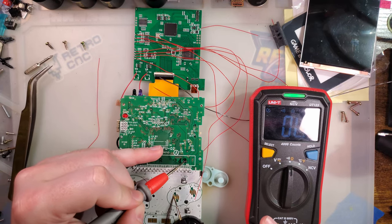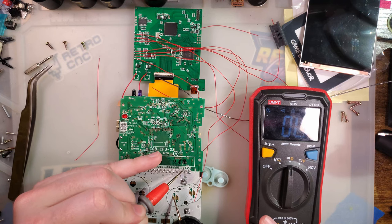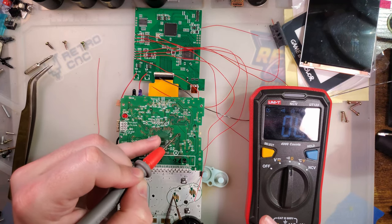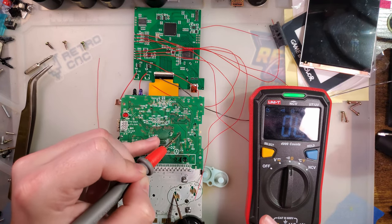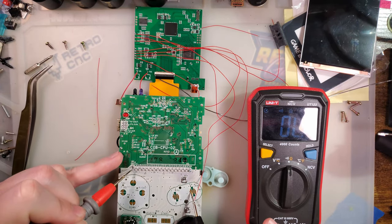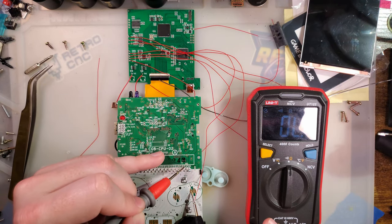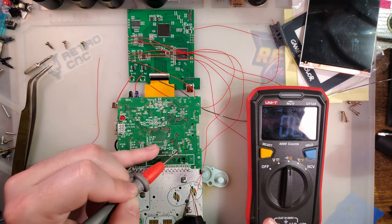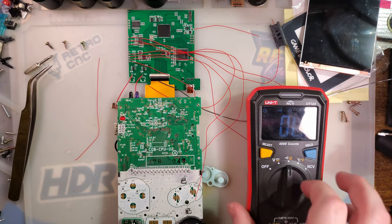So in this particular case, B is connected to, if you look at the cart slot right above the WR pin, that's what B is connected to, or we can use, in this cluster of four, the bottom right one. I'm going to go with the bottom right of that cluster of four. We will also need A, which is probably that top one in that cluster of four, yep, and the right one right above the not pin. I don't know what that actually is. It's a little circle with a line through it. But it's to the right of B. But I'm going to use that one up there.